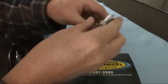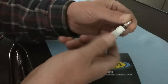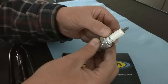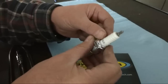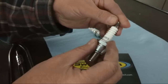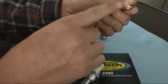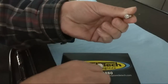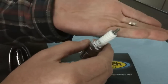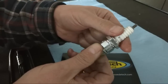Now for the more general stuff. On this plug — which is why I grabbed the B10 intentionally — these tops twist off. Just last week I was servicing two carts, and on both of them this was loose or completely stripped out. When we pulled the plug cap off, this piece right here was inside the plug cap. The aluminum had stripped out of the cap, and it caused an electrical problem for that customer.